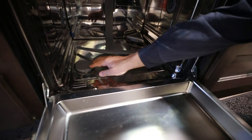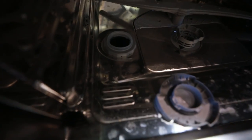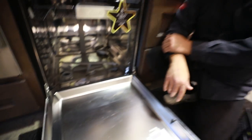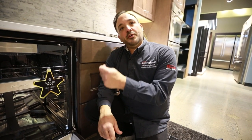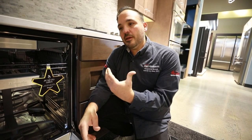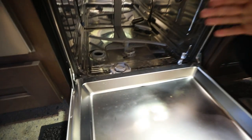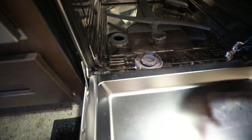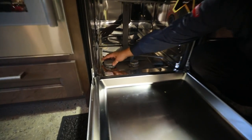There are two other features in this step-up model. This one right here is for your salt — you're going to put a box of salt in there and a cup of water. This helps if you have hard water in your area. With hard water, you'd see etching on your glasses — a cloudy white film, or a slimy feeling. If you know your area has hard water, this will treat it. It should last around six months, depleting out and evening the pH levels in your water.